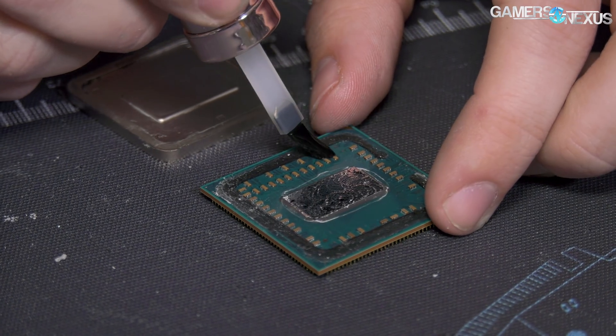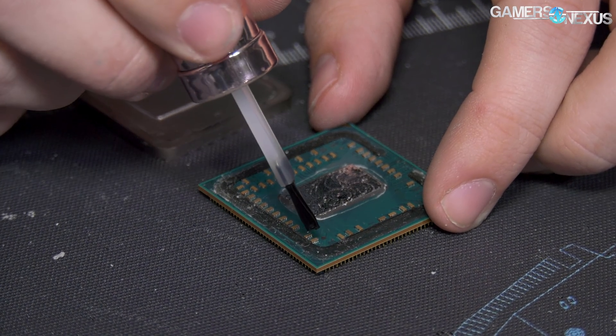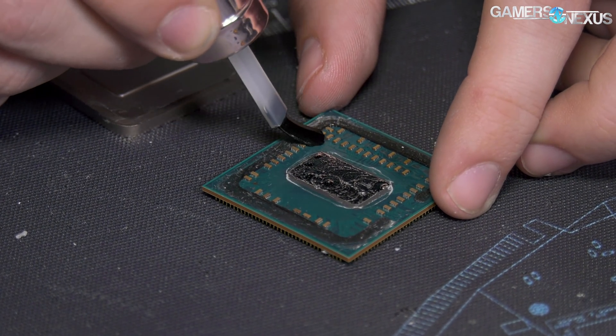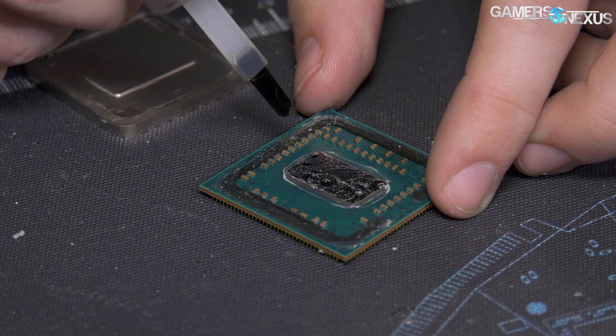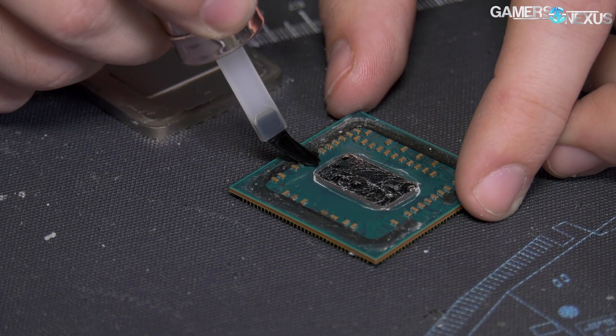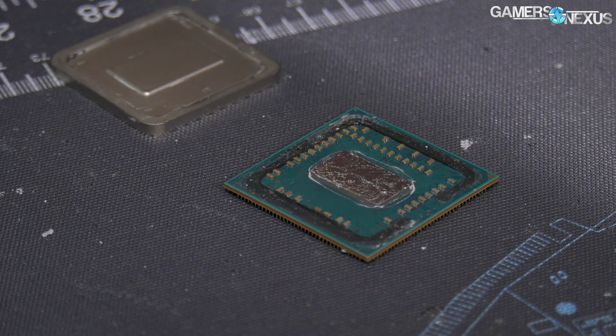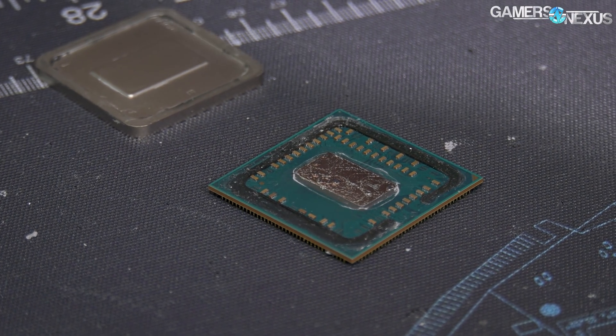We're not attempting a serious overclock here. We have it at 3.8 GHz and 1.4 volts — that's not a big jump. The point was not to push it as far as we could, but to generate a very reliable set of thermal data by pushing a consistent voltage through it. Instability on these APUs is such that it was hard enough getting them to work at all with any kind of overclock on any board.